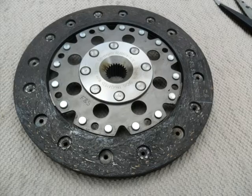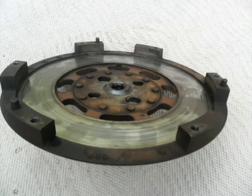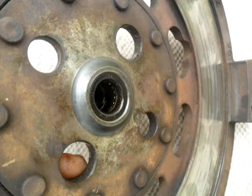What is the main problem with the clutch? It doesn't declutch — it doesn't release the clutch disc. When you operate the servo, I put it with the vacuum machine, you saw it. It won't release. So the disc is dragging.